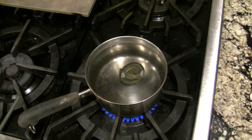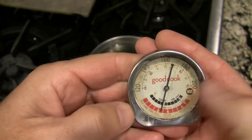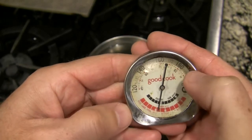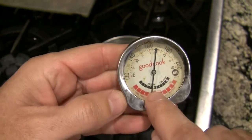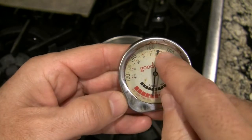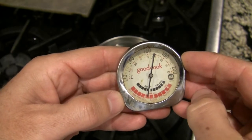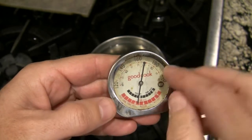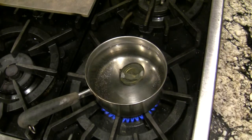This is simple enough — I've got some cold water in there and I grabbed a meat thermometer that's measured in Fahrenheit. There's my 180. When this needle comes up around here — this is the indicator side, that's the back side — it'll have to come more than 180 degrees, but when I reach 180 I should see that thermostat start to open up.